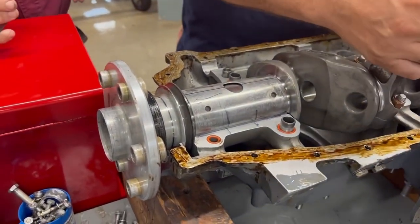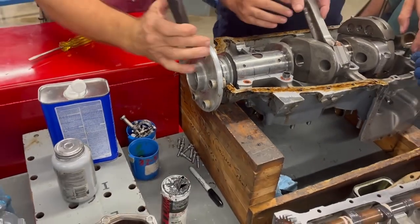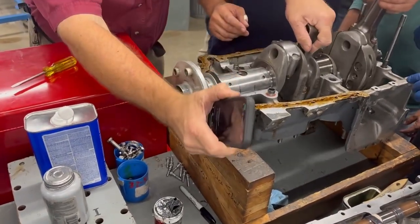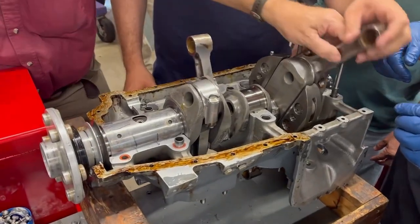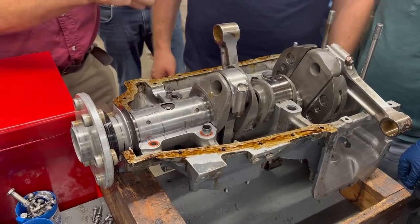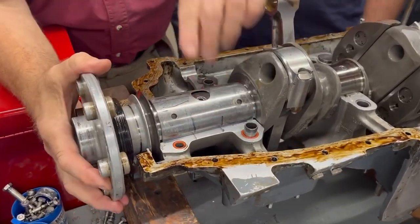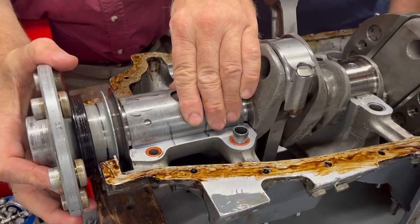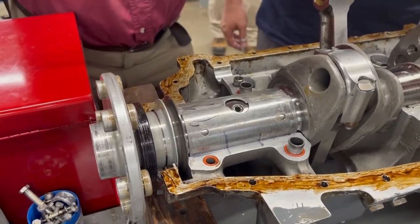Carefully set your rods so they don't smack down. And this one — if you rotate the crank a little bit — stop right there — this one will set like that, and just carefully lay this one over. So now we can just take the bearing here. I'll let you guys hold that again and locate it, so we've got our reference marks.